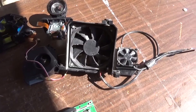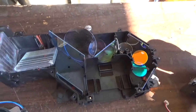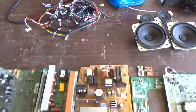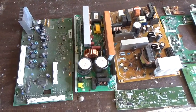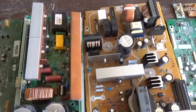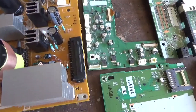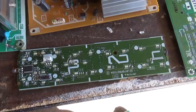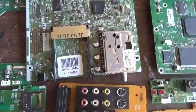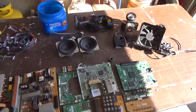At the end of this teardown I got some really cool fans — especially this tiny squirrel cage fan — projection lenses of all types, a couple of speakers I might sell or break down for the magnets, a bunch of wire, and all the screws. Here are all the boards: basically a lot of low to mid grade boards. That's the power board with all the copper on it, there's another power board with copper, a low grade yellow board, some very tiny boards, boards out of the remote. Only one — actually two — that are probably mid grade, and there's the only high grade board in the entire television.